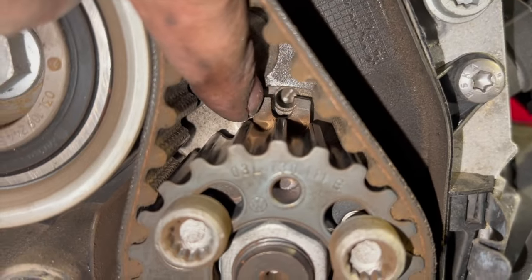But just where it's situated at the minute, there is a bit of float in there. It is slightly to the left-hand side still, as you can see in the guide there. But the pulley on the bolt on the camshaft, sorry, it's quite nice and central. Obviously that will pull slightly round there, but it shouldn't land in too bad a position really. So at this stage now, just recheck, just make sure your timing marks are all lined up bang on again. It's always worth just keep checking them. But now we're ready to put some tension on it.